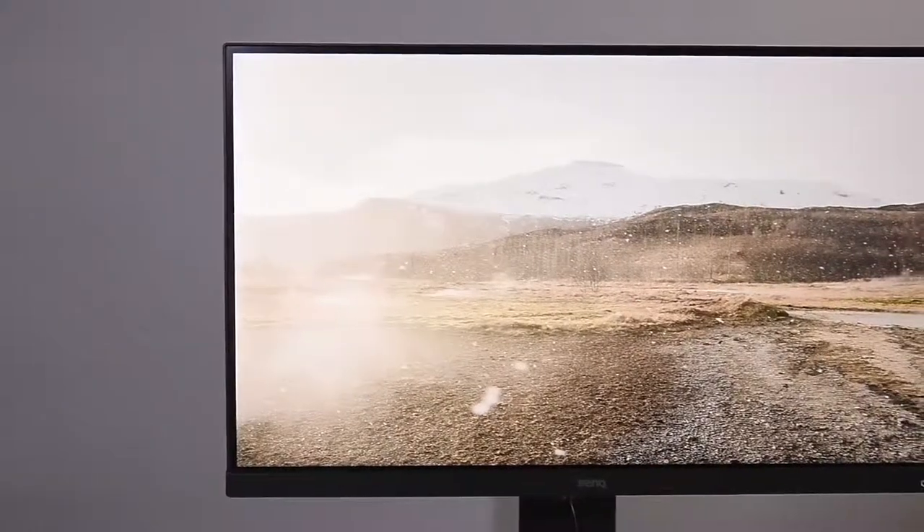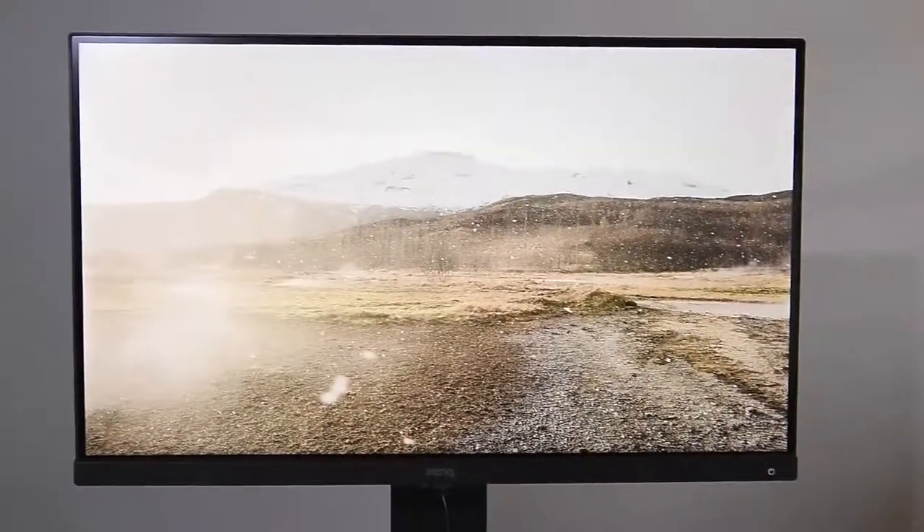To give a little background: being able to display 99% Adobe RGB is the gold standard in the hardware calibrated display industry right now. If you're a videographer, you may be more concerned about the DCI-P3 color space, which is designed more for video. Amazingly, all current BenQ displays with upgraded firmware — including this one — can be switched to DCI-P3 right out of the box. They come pre-programmed with DCI-P3, Adobe RGB, sRGB, and a few other color spaces. As a photographer, you're looking for a display that can show 99% Adobe RGB, which means a lot of colors, a lot of color depth, and deep saturation.